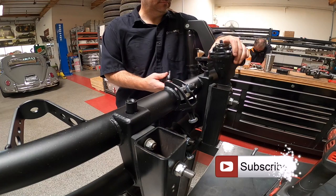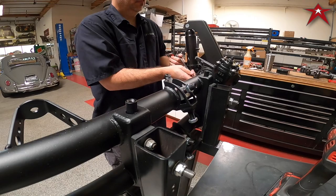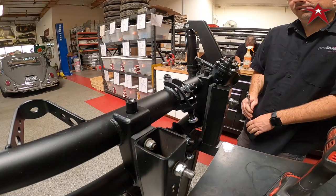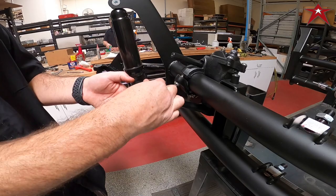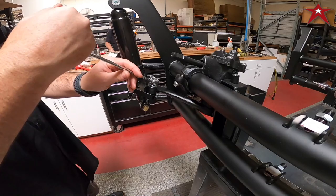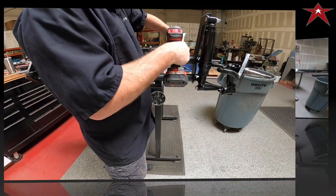We're installing the pro built steering box — link below. It has centering pins on the back to allow the tilt of the box to match the angle of your steering column; tighten those to get the right angle. On all link pin air ride kits we use what's called a quick steer, which lengthens the gap between the shock and the tie rod. If you don't use this, when you lay the car down the tie rod will hit the shock — and that's a no bueno. Next, we installed the steering dampener.